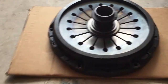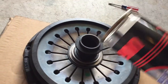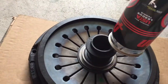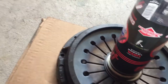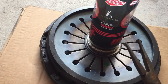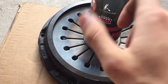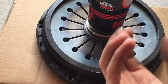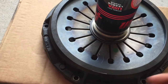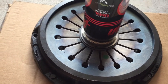I used a tennis ball container, and I fit it over the hub, and I pressed down on the snap ring, because what would happen was when I used the snap ring tool to expand the snap ring, it would flex and twist itself. It's so big and so thin that when you try to expand it and make it wider, it twists